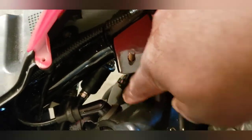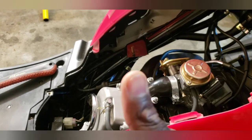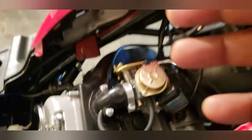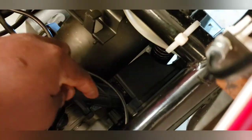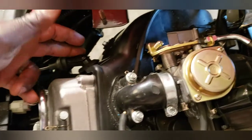So I'm getting close. One of the reasons I'm getting pretty close is I figured out why. On these there's a spark plug right in here, and there are three things this bike needs — just like any car or any other vehicle — it needs air, it needs fuel, it needs spark. The best way to do it is to literally go through the whole entire thing starting with the first one, which is air. This is the air box down there — it comes right in here, goes into the back of the throttle, and we're good on that; we've got nice ventilation.